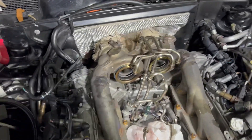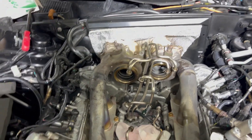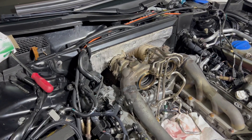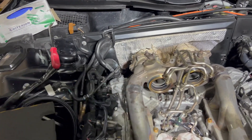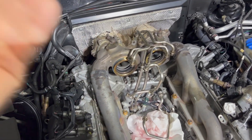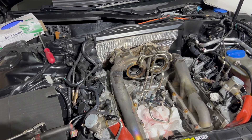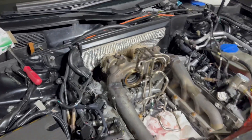We can't do much more with the hybrid setup because the limiting factor is the hot side A/R — it's too small to push a bigger turbine wheel. There's only so much exhaust you can physically push through that housing. I thought about full-frame turbos like the G25-550 originals, but there's just not enough room and it requires too much fabrication with cooling lines, oil lines, charge pipes, and everything else. The single turbo will be a lot less work, and it's a quick change — if I want smaller or bigger, no problem. I can probably swap it in less than an hour with my setup.